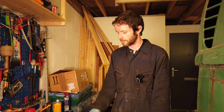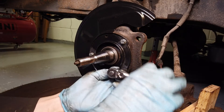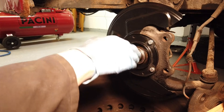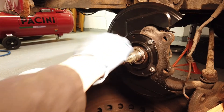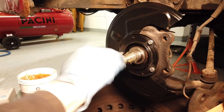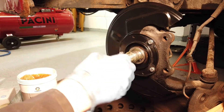We've painted up the holes that we made, put a bit of stone chip on them, and got them onto the red van. It's good to put some fresh grease onto the axle before you put everything back together. I've cleaned it down and I'm putting on some fresh lithium grease. You've got to grease all the other parts as well, like the wheel bearings - the inner and outer wheel bearings - and anything around here basically.